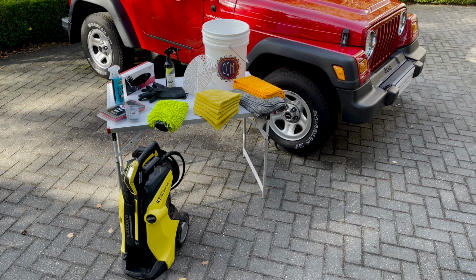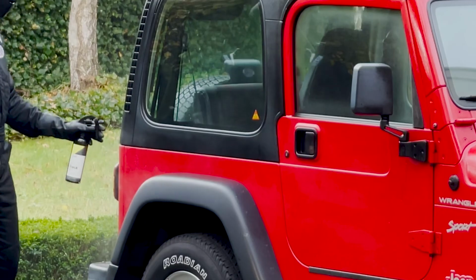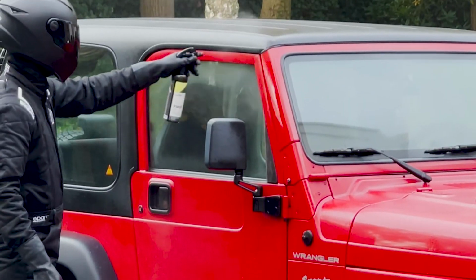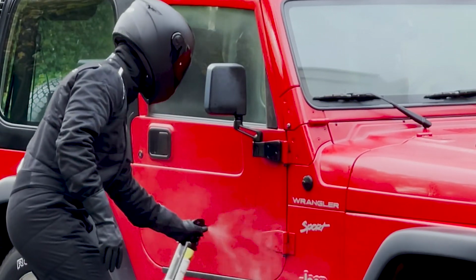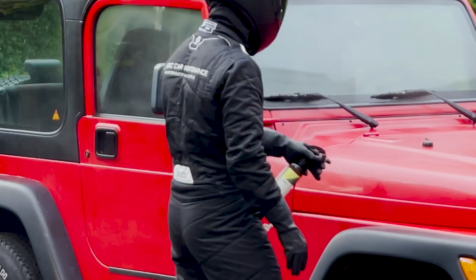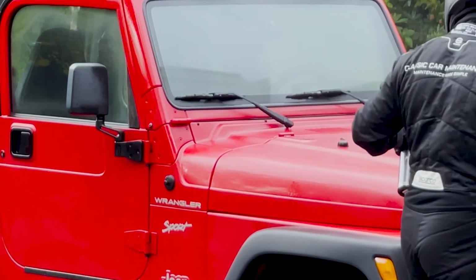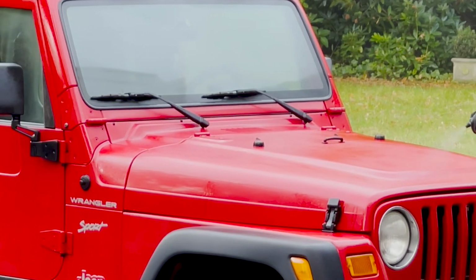Although not strictly necessary, we do recommend spraying your car paint with iron remover spray before clay barring. This should be done right after you've washed your car. There's thousands, maybe millions of tiny metal flakes that are dispersed by your brake shoes and brake discs each time you brake. These particles are scorching hot when they land on your car paint and stick to it. If you don't remove them, they will start to corrode, expand, and damage your car coating.